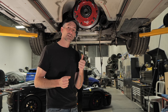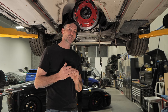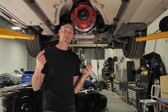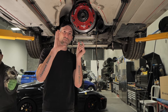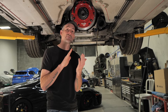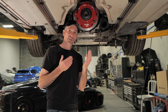We were able to look up the parts and get a new clutch for it. We're also adjusting the spacing on the torque tube. All of these earlier Vantages come with a spacer behind the release bearing, and when you look at our twin-plate kits for standard cars, we change that spacing to close up the space to the bearing relative to the total deck height of the clutch. We noticed the clutch pedal take-up was a little high in the travel, which can happen as the clutch wears or if it's just not set up right.